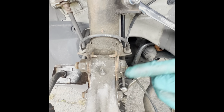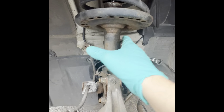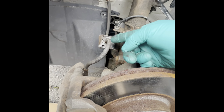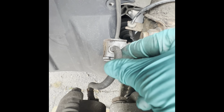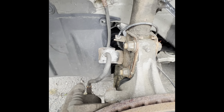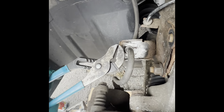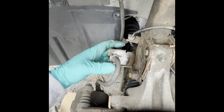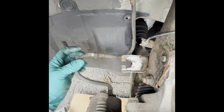Once you remove these two bolts and the three bolts on the top, you should be able to take the strut out. Don't forget — you also have to remove the brake line clip retainer right here. You push it out in this direction and it comes right out, and then you're able to remove the hose. You insert it in and out that way and it comes out. All you have to do is try to remove it just like so, and once you do that you're able to push this in and out and it's released.